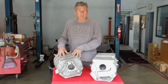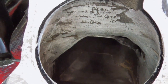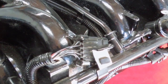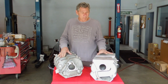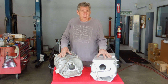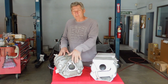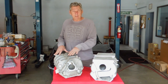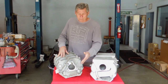When we take this manifold and modify it for truck use — and we want to make more horsepower — we modify the inside of the intake manifold, cut the bottom out, remove a couple panels inside, weld it all back together, and then clean up the ports on the outside. We get an airflow increase of about 80% of what this manifold is capable of. This manifold will make 650 horsepower out of a 496 with the 206 camshaft. It works really well for trucks because it's still emissions compatible — it has all the hookups for the EGR valve, the charcoal canister, the MAP sensor — everything it takes to make your truck still be smog-legal and capable of moving enough air to make some good horsepower.